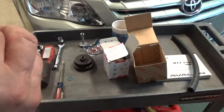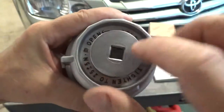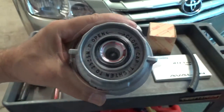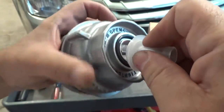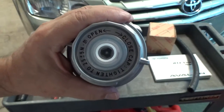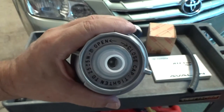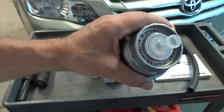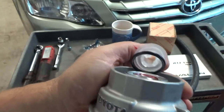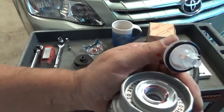The official Toyota instructions: remove the bolt — they're calling this a bolt; it's a 3/8 square — then insert the service pipe and let it drain. After it's all drained out you can remove it. If you follow their instructions it should come off like I showed you earlier.